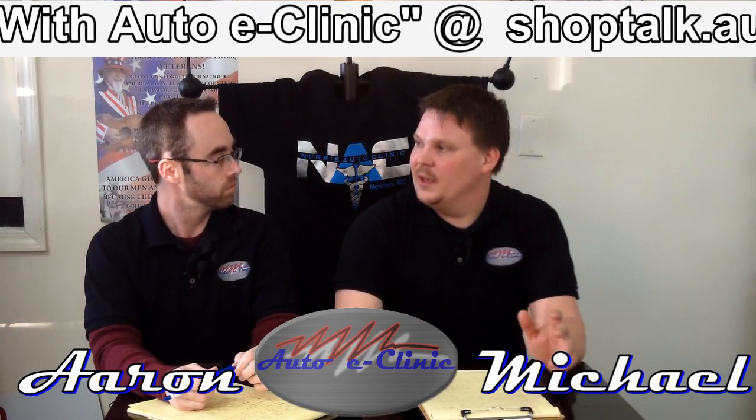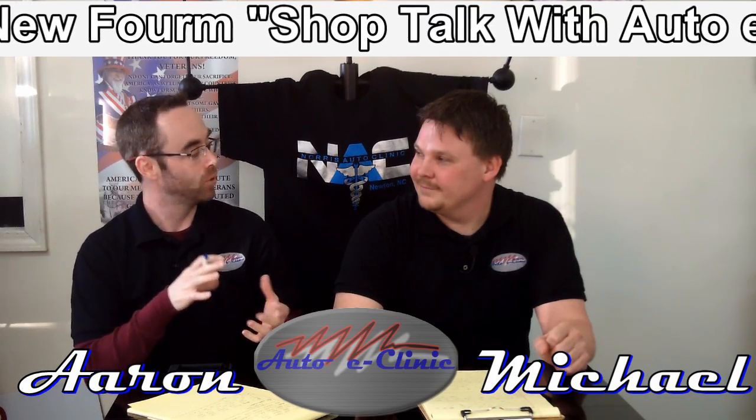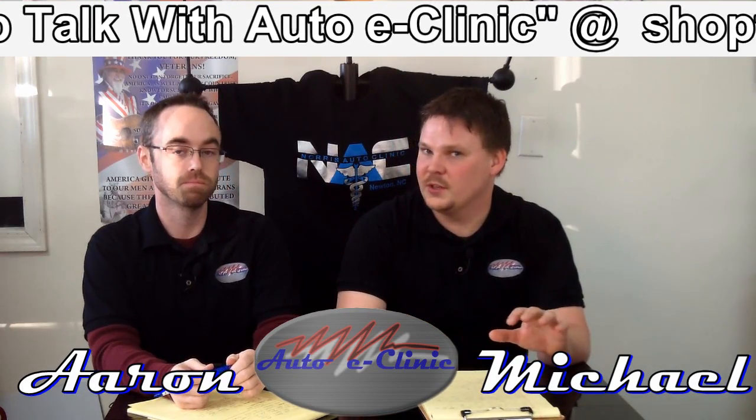Back when I started in this business, we actually would have rebuilt them ourselves — taking the grease out, cleaning them out, putting new grease and new boots in. Then they came up with rebuilt ones you can buy at the parts store, which were pretty cost-affordable. Now they've got brand new ones that are very cost-effective, and I've had less than 10% turn out bad. The only thing you don't want to do is go with split boots. By the time you put a split boot on, you can charge the same labor and just put a new axle in — the customer comes out much better. More than likely if the boot is torn, there's water and debris in it anyway and the joint's already damaged. Any time you put a new boot on, you want to clean out all the old grease and dirt and fill it with new grease. A split boot is not an effective repair.